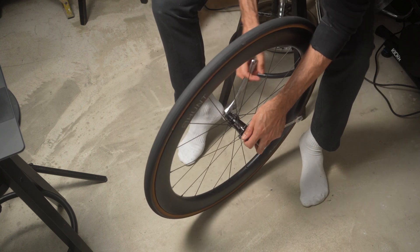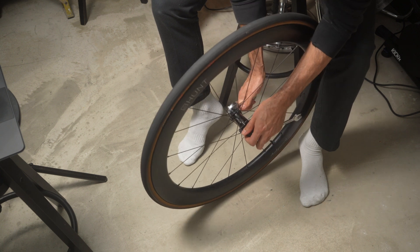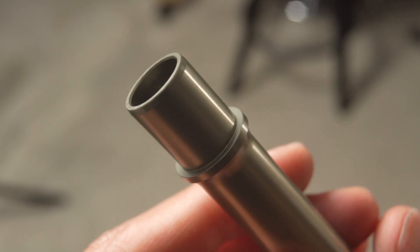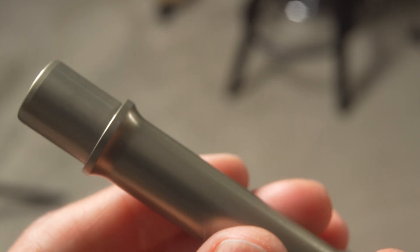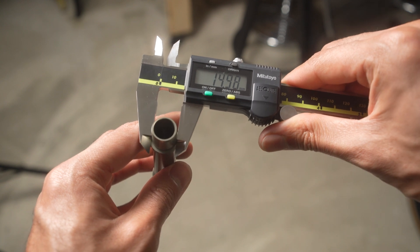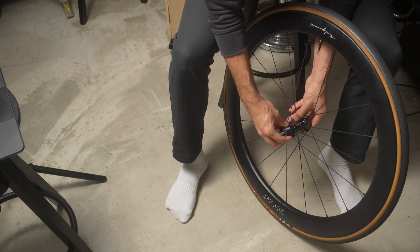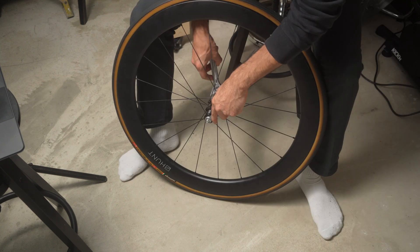I started with the centre lock side, just because the tool I had has better purchase on that side, and then I used the drift to push the axle through, which pushed out the bearing. Once the axle was out I did a visual inspection — the axle looks very clean, no signs of galling or anything like that; in fact it looks like it's had a very easy life. Out of interest I took some measurements — no obvious asymmetry or anything like that. Did the same process to get the bearing on the other side out; this one was noticeably stiffer and popped out with a satisfying ting.